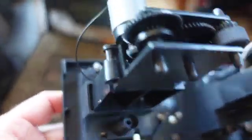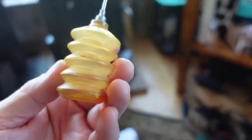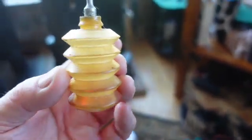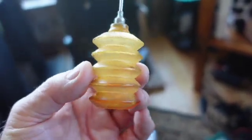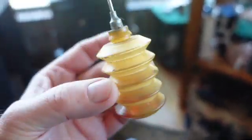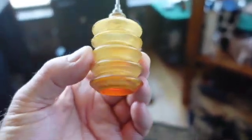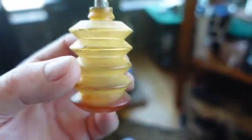Just like clockworks, it's going to need some lubrication. And what I've got to do that with is my little precision oiler that I've had for a long time. I usually use transmission oil in that because it's high detergent, lightweight, 20-ish weight. I can get in there with this. It's like for guns and whatnot. It's a really lovely little oiler. I've had it a very long time. I'm surprised that the plastic has held up. It's just that good kind of plastic.